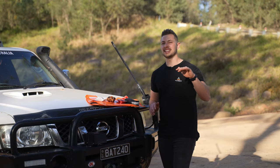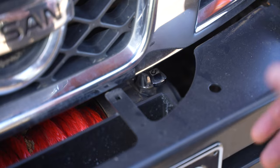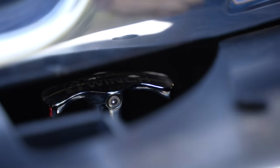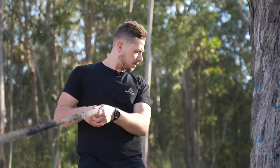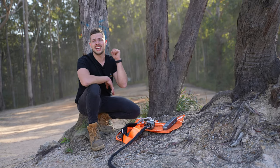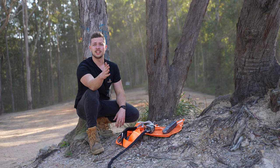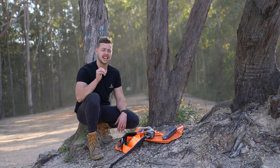While we're in a bit of a controlled setting, I wanted to show you how to set up a simple winch recovery. First step: unlock the clutch on the winch. With the Carbon, it's as simple as pulling up and twisting to the side, so you're able to free spool the winch out. For this recovery, you're going to be hooking up to the tree behind me. Make sure you're picking out a nice solid tree — not dead, not going to fall over. Also make sure you're in a straight line back to your vehicle; you don't want it on too much of an angle if you can avoid that.